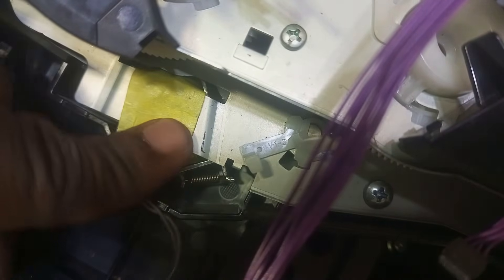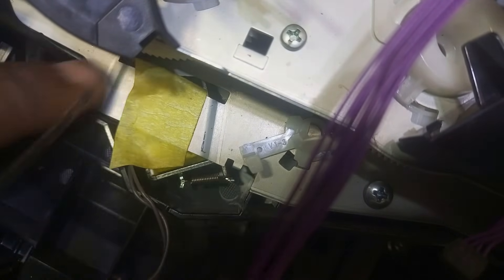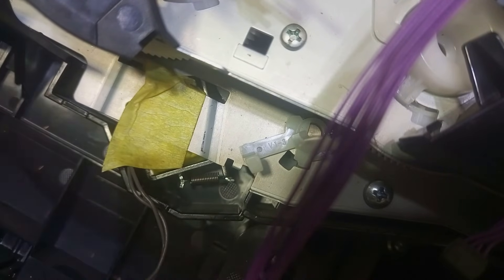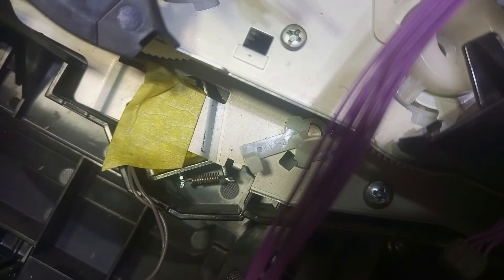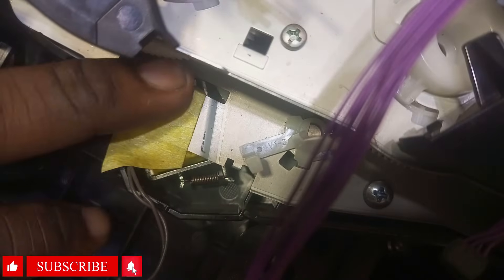I was able to use my scissors to trim it down. So this is what it's going to look like — you can see it's going to bounce back and forth and nothing is going to hold it back again like before, so the problem right here is solved. What we want to ensure is that once this spring moves back and forth, nothing will hold it back. So what we'll do now is couple the printer back just the way it is, attach all the cables the way they're supposed to be, and the 59.COL error problem is solved.